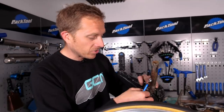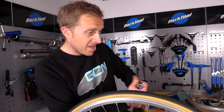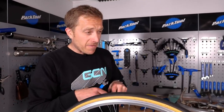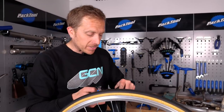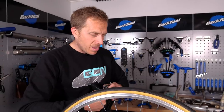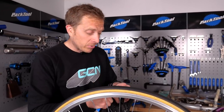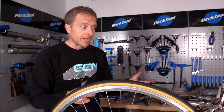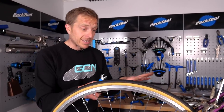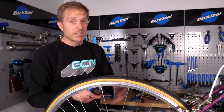I've got to now just swap over the saddle clamp assembly. It's been fitted back to front - possibly the person who owned it before was rather short in the upper body and wanted to get far forward, or maybe there were time trials on it. Either way, it needs to go on the back. It's quite a simple affair - you just need to get it released and then fit it onto that new seat post along with the Brooks saddle. The last thing to do really is just wrap the handlebars, and also fit the cleats on the bottom of Si's shoes. I'm pretty particular when it comes to cleat setup - toe clips have no float at all, whereas a clipless pedal has quite a bit. Mark Cavendish, when I spoke to him about his own cleat setup, said he did it all himself because he obsessed over that detail. So Si - if Cav does it, you can do it too, mate.